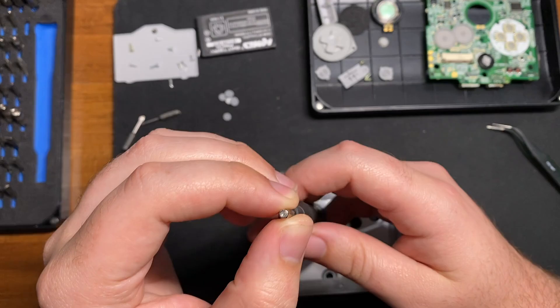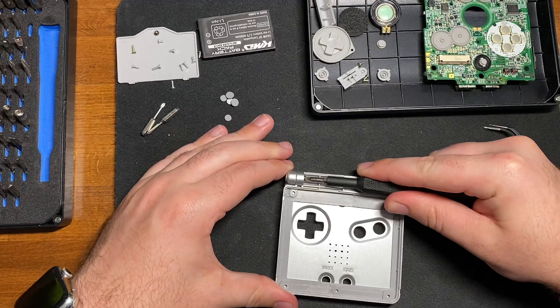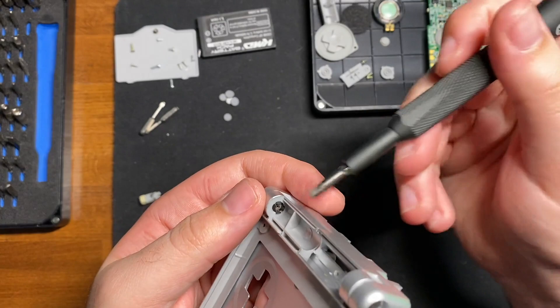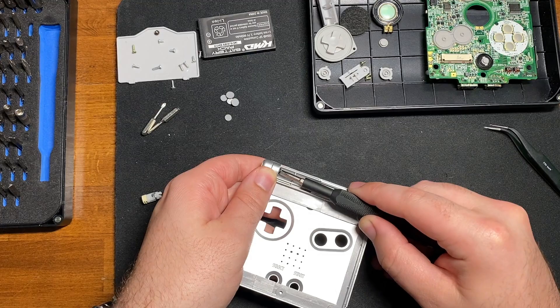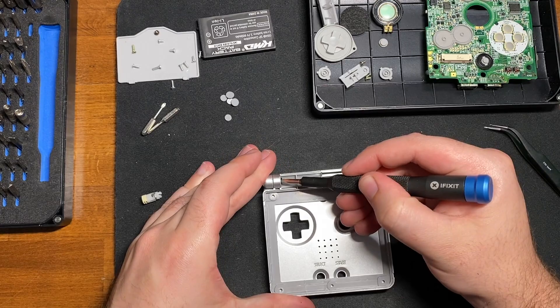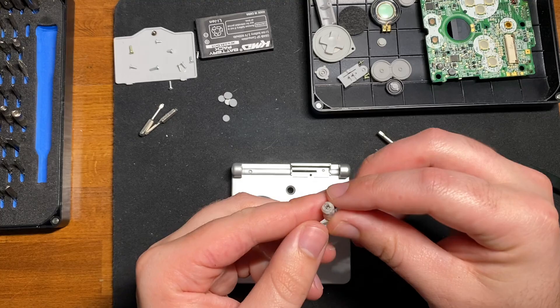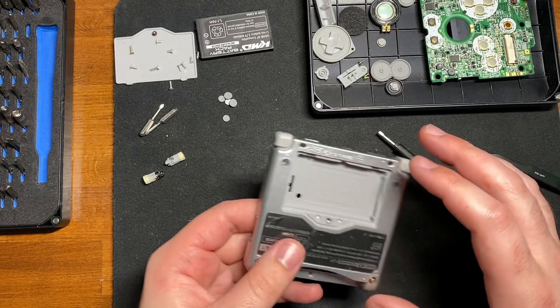Take the screw out and set it off to the side. The next step is to pop the hinges out. I find this can be a little troublesome. I use something like an Allen wrench key — something big and flat that won't possibly damage the housing like a Phillips tip would. Put it right in the middle and then just push. You're going to feel like you're pushing too hard — just keep pushing. There are some clips that kind of flange out so it locks in. You might have to fiddle with them to collapse them back down and into the hole. They shouldn't be too difficult. They are also color coordinated: black is usually on the left and white is on the right. Make sure you have something to catch them so they don't go flying.